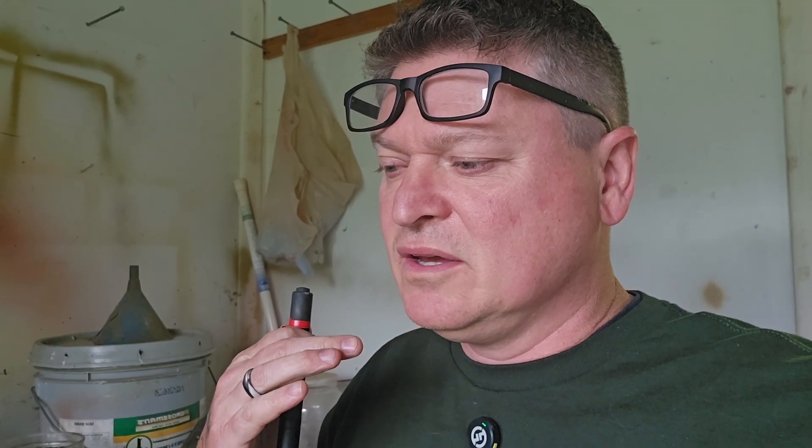Most of these things are all just the same. The only difference is quality. The setup of the cylinder for most of these — Chinese made, Taiwanese made, I don't care where it's made — aftermarket cylinders, they're all using the same molds. So it's more likely that you're going to get the exact same numbers. The difference will be all the burrs will be taken off, it'll have a better finish inside the cylinder, a higher grade of alloy — things of that nature. But the numbers are probably going to be about the same.